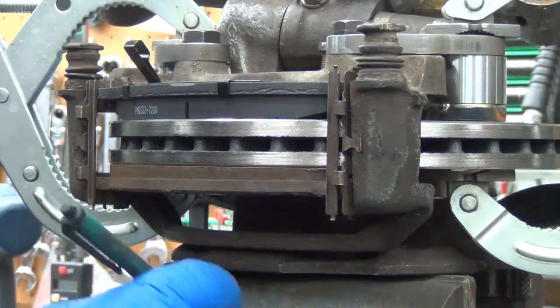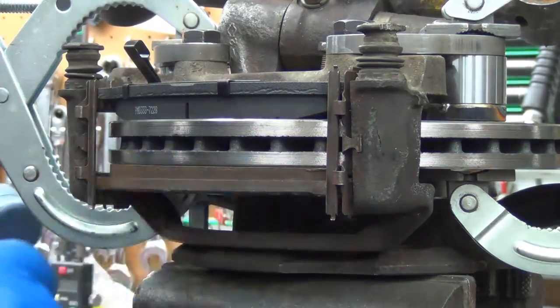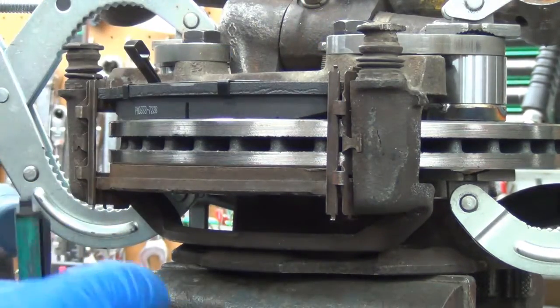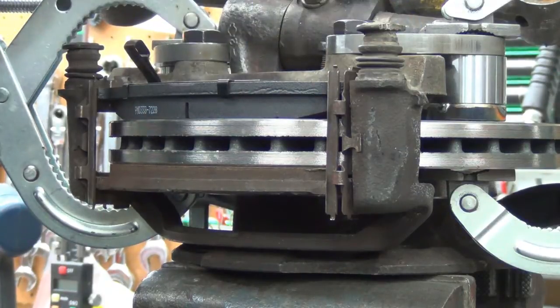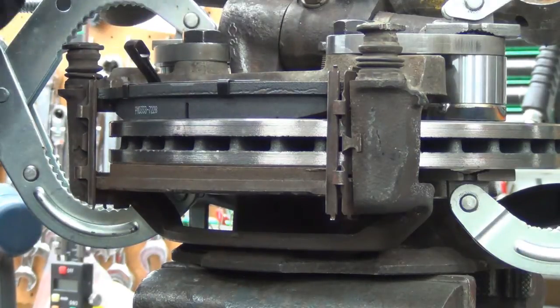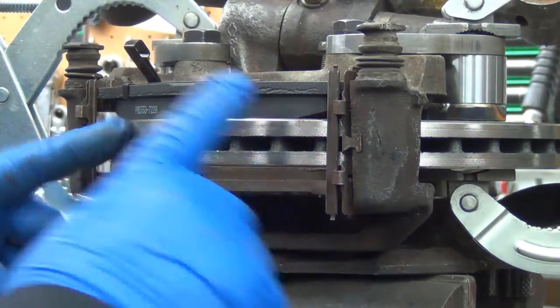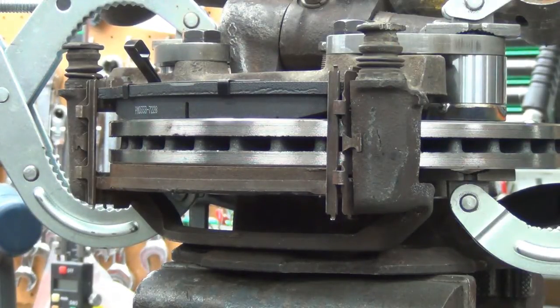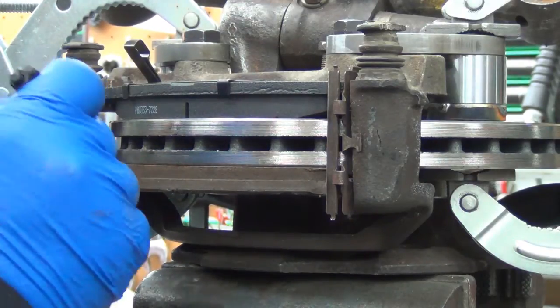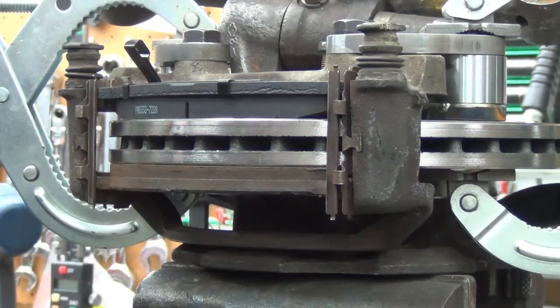The comment made about having the backing plate - the steel part - concentric with the rotor: for right now for testing I'm moving it around and they're completely right. When these get put together I'll be tacking them and test fitting, and the jig will be done in CAD. That way I can make sure these two bolts are perfectly concentric with everything else. Since there's still at least a sixteenth of an inch here, this pad can wear down probably to about half of what it is now and still have enough metal overlapping to not pop out.